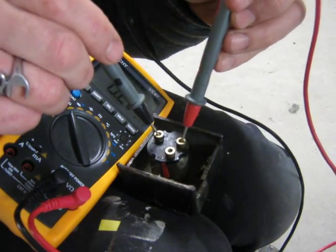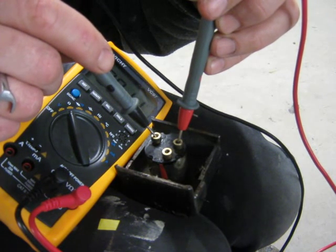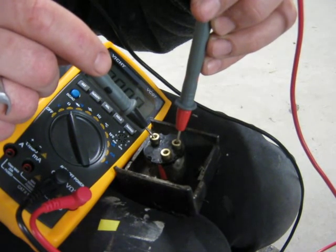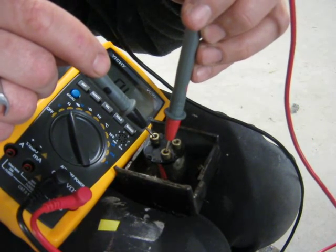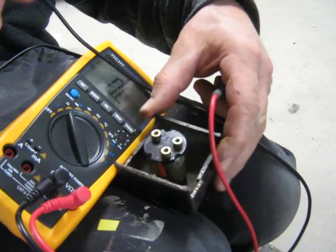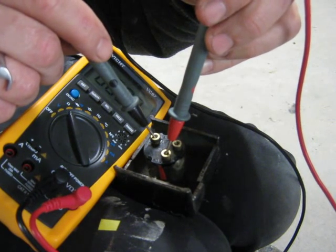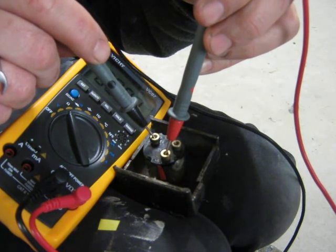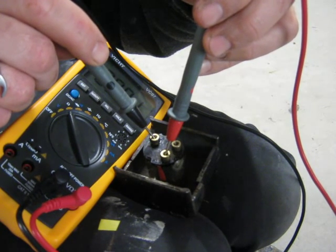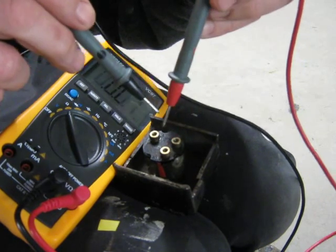So it's on accessories. That's the accessories there — so that's a good reading. Point nine, point one — or point nine or one. This is an open loop. Okay, so that's perfect — that's a perfect reading. I'll turn it to on again. And it should be from there to there — the ignition. This time we're getting a good reading. Okay, that should settle right down to four zeros. That's a good reading. And this should be an open loop.